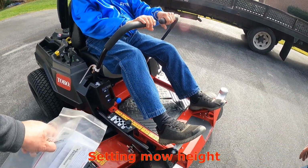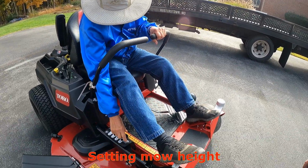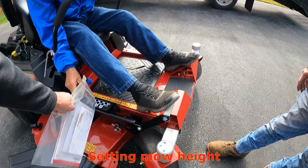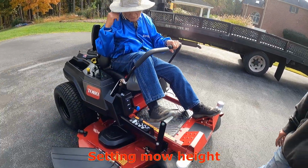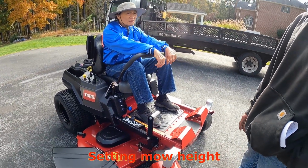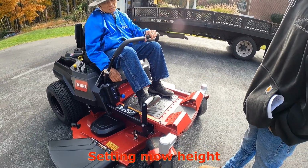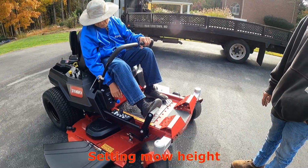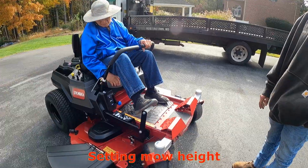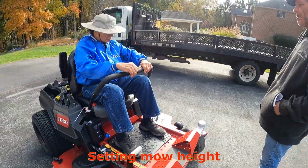Yeah. Well, let's see you set it down to 2 or 3, or 2.5. Go to 2.5. You've got to push it all the way in first. Yep, push it all the way first. Then 2.5. Well, that's 2. 2.5 would be here on that side. I think that's where we've been cutting. Like I said, you might want to try a little higher. I'd go 3. Yeah, because there might be a little bit of variation in tire size or something like that, and we don't want to look like we're scalping. Right. All right, go ahead and fold the arms back out and restart it.